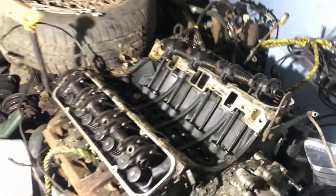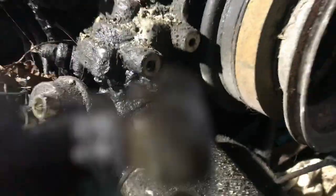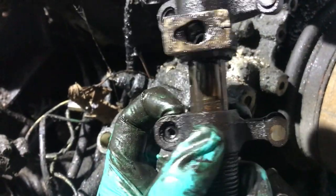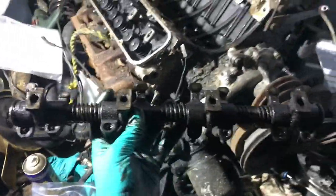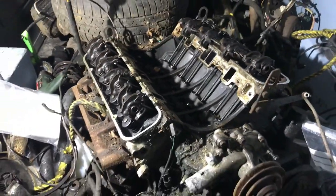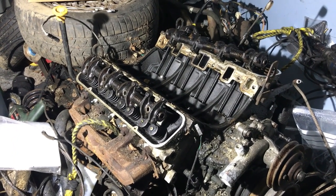The rocker gear looks really good. The rockers usually wear a groove in the underside of the shaft, and although there's dirt here, there's no wear lip, which is really unusual. It basically paints a picture of an engine that was really well serviced. There's just a little bit of cleaning and linishing of the pads needed. This probably just wants a good clean and can be reused — though I know I've got a brand new set of genuine British Leyland rocker arms somewhere in store.